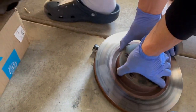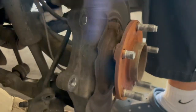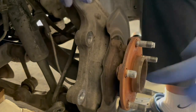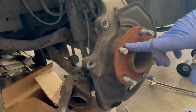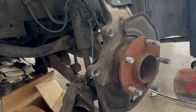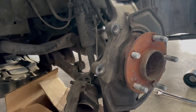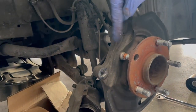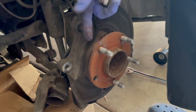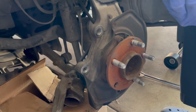Now what we're going to do is rotate the rotor into this open window so we can hammer the stud out. You have enough clearance behind the shield so the stud won't touch. We already moved this one a good amount — maybe about a millimeter. The idea is to just hammer it and it'll come out through the window. We'll see how the second one goes because it's longer — we might not have the same clearance, but that's how you take it off.